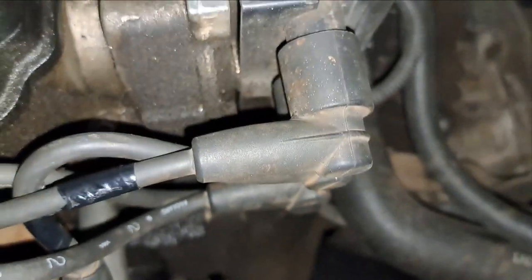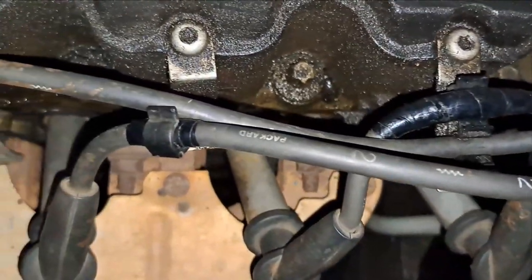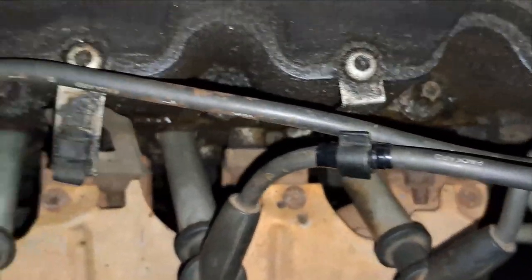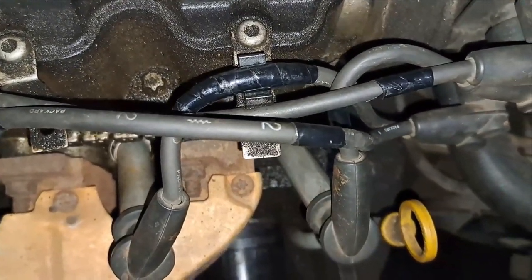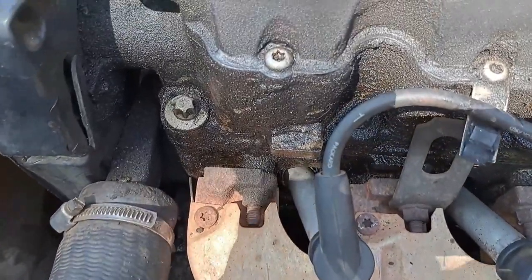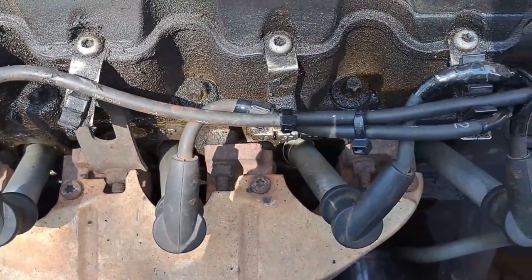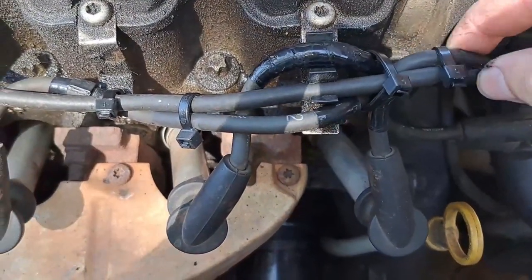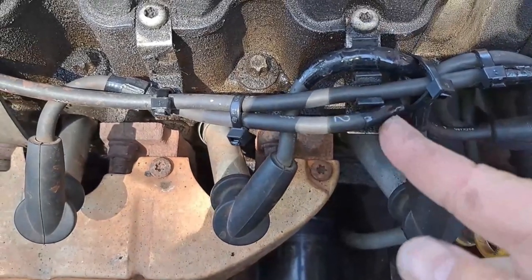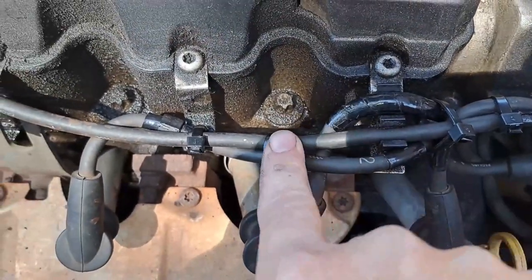There was no more jerky motions, no spark loss, no jerky jerky — nothing. So all I did was take cable ties and cable tied the cables nice and tight so they don't scuff anymore. I have zip tied the cables together to make sure that they don't rub anywhere anymore, causing them to rub through. So they're all nice and secure.